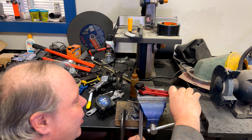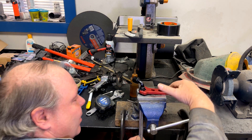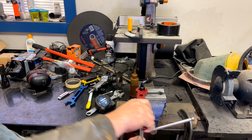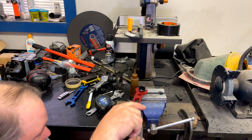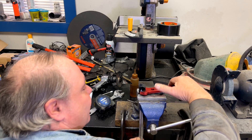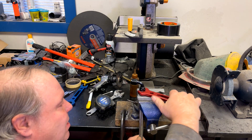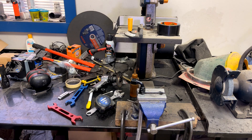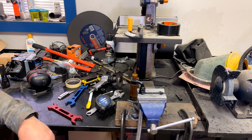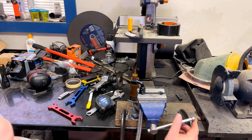If you're doing this with aluminum fitting wrenches like this, it's a lot easier on the fittings — it doesn't damage them, it doesn't mark them, and even when they're tight, you're a lot less likely to distort them. So that's down tight — the two halves of the fittings are properly tightened together. That's your hose end.